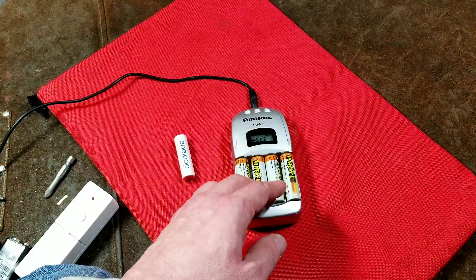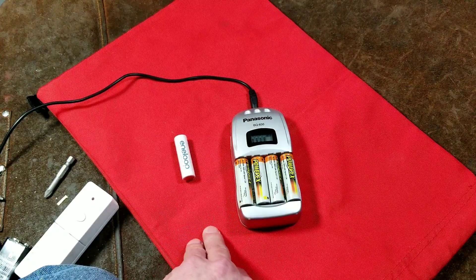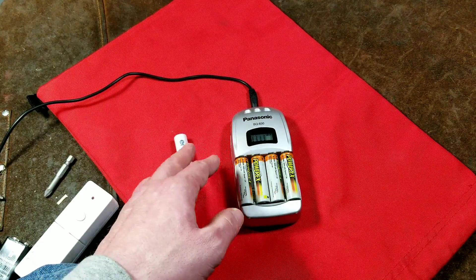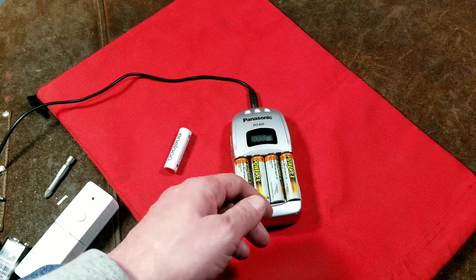It always seems a little more cooperative, and you get more life out of rechargeables when you're not burning them up trying to super quick charge them. The same thing goes with your cell phone — if you have an Android phone, you can go into the power management options and under battery disable quick charging, and you'll actually get batteries that last a lot longer.